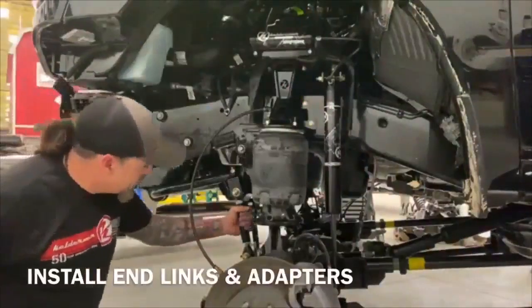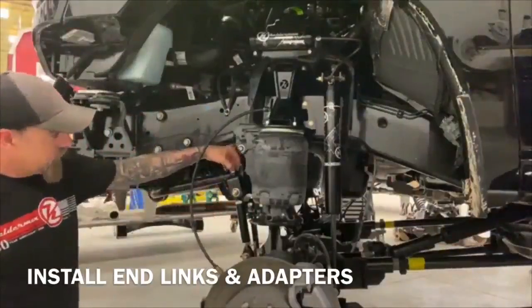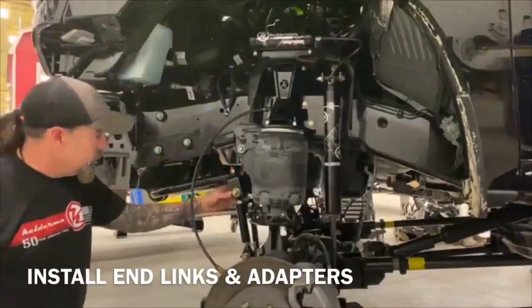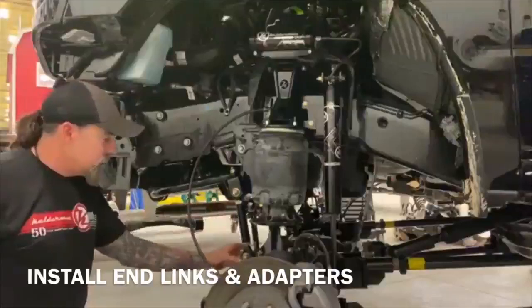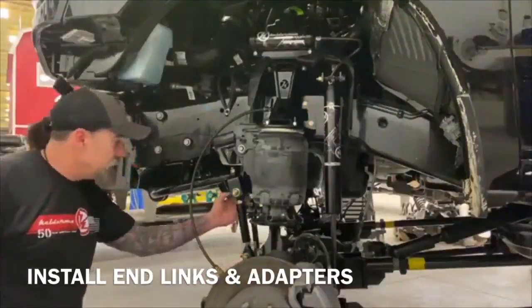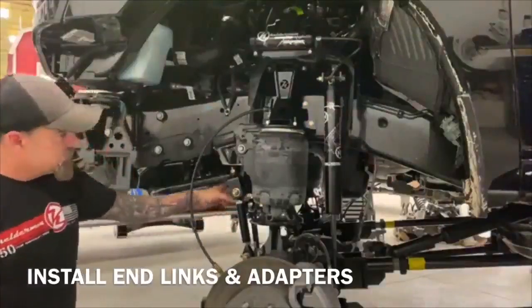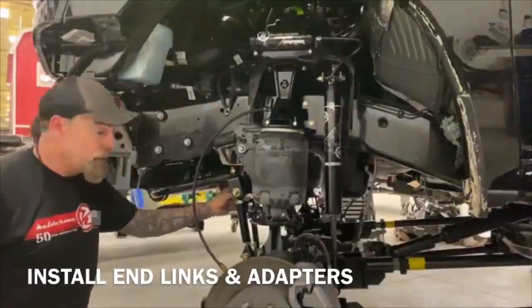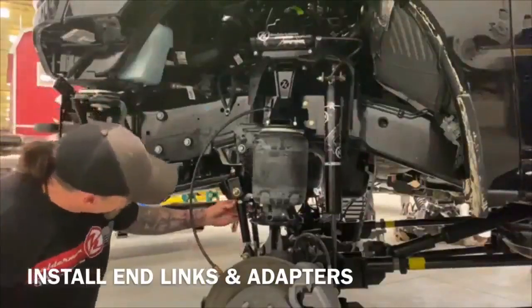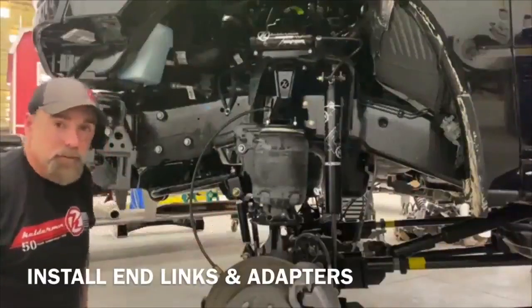We provide longer sway bar end links. We have a little adapter bracket that just bolts on here with a half-inch bolt to the end of the OEM sway bar. These use 9/16 bolts and there are little spacers on here, so make sure you get those orientated the correct way. Run the bolt in — if you run it too far it's going to scratch up on your panhard bar drop, and we don't want that. We just run only about a thread on them so you can check to make sure both sides are the same length when you're installing.